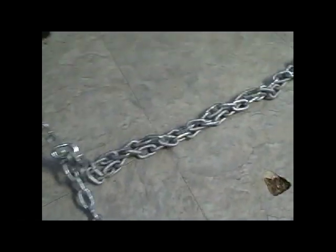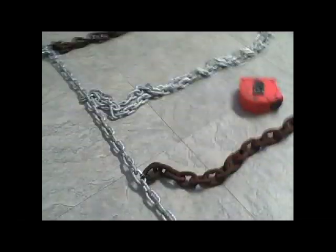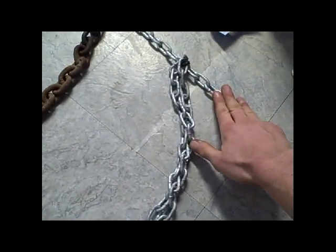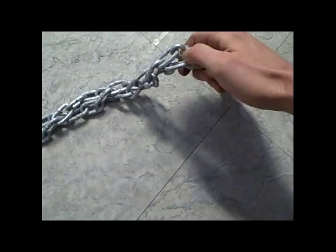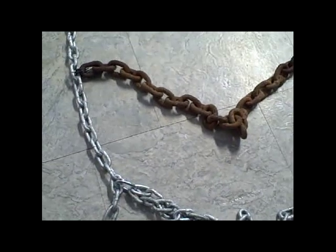This is chain number one. It is a little bit snowy outside right now, otherwise I would go try to fit these onto my tractor and check the fit before I start making number two — because if I need to make any adjustments in the length, I want to do that before I get them all cut out. I can always cut the circumference chain or add an extension. It's really easy to add lengtheners to the ends if it's too short. If it's too long, I can take a rib off and shorten it, but lengthening or shortening the ribs themselves probably isn't going to happen.